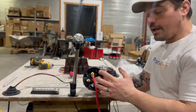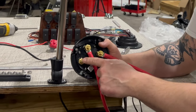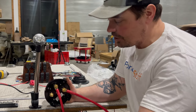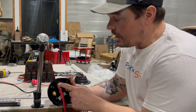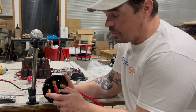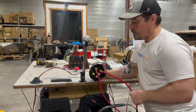My feeder post — often referred to as a common or shared post — this is where all of my accessories and my motor positives are all going to hook. When I turn the switch, what it's doing is taking power from battery one and applying it to the feeder post — my accessories and engine. When I turn it to two, it's taking only battery two power and supplying it to the feeder. When it's on both, it's taking batteries one and two in parallel — still 12 volts — but supplying both together to the feeder post. Likewise, power coming back in from the engine for charging purposes is going to go to whichever battery we've selected, or both.